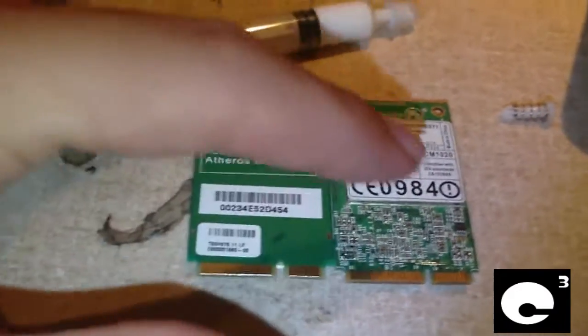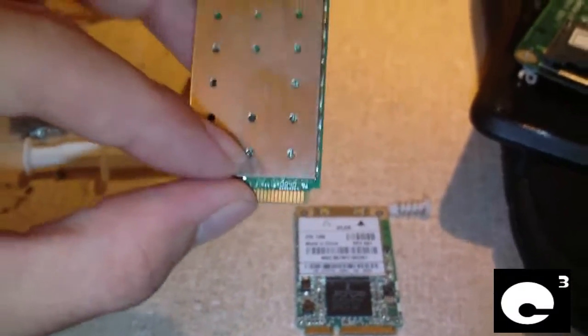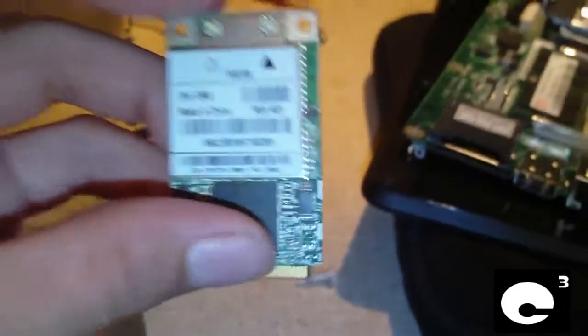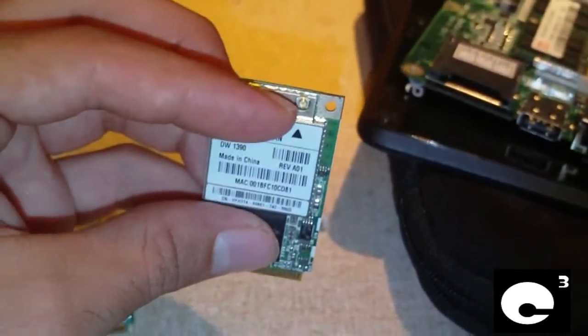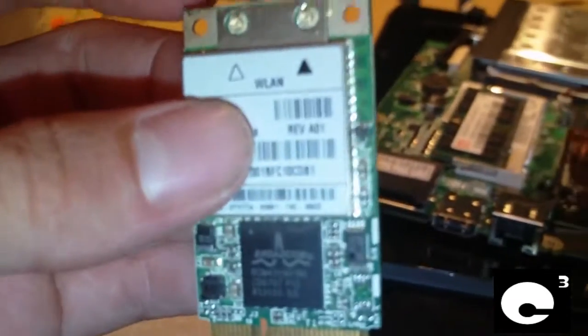Let's compare it with a different one. This one on the right came out of a Dell Inspiron notebook manufactured in 2007. Flipping these over so you can have a look at the other side — this one has one giant metal plate on this side, but there's barely anything at all on the Acer card's side. They were so cheap they couldn't even label where to properly install the wires. Notice on this one it's labeled where to attach certain wires. Of course, in laptops you have a black and a white wire going to your Wi-Fi card. This Wi-Fi card has a Broadcom chip on it, while the Acer one has an Atheros. So I'm going to pop this bad boy in and see how it does.